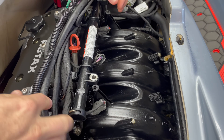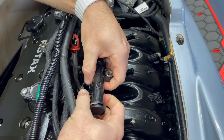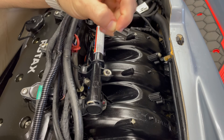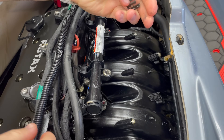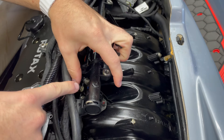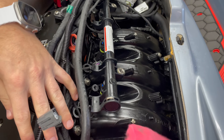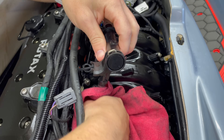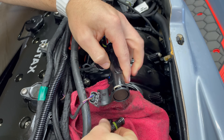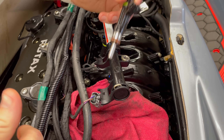The injectors are now removed, so we can go ahead and pull out the clips. These are the clips that hold the fuel rail to the injector — basically just squeezes the two of them together. There's probably still some fuel pressure in here, so I'm going to put a rag down just because I imagine there's still some fuel pressure and we'll pull this injector out. Yep, just a small amount, not too crazy. So I'm going to do this to the rest of the injectors and then we'll move on over to the flow test.